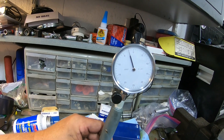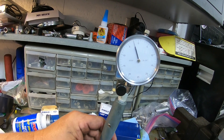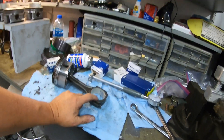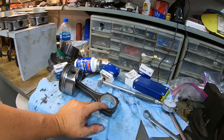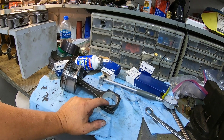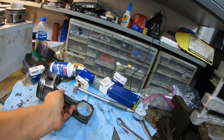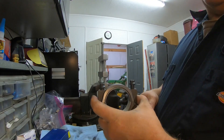It's just past 0.002 — about 0.0022. I'm trying to hit 0.0025 and I definitely don't want anything less than 0.002. Being at 0.0022 I'm not going to sweat it at all — that 0.0015 was really tight, but 0.0022 we'll call good and move on.